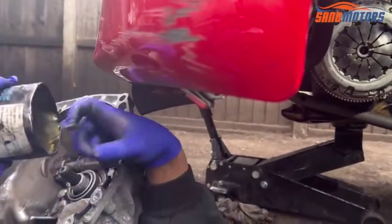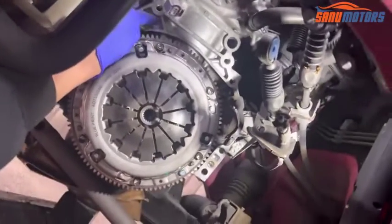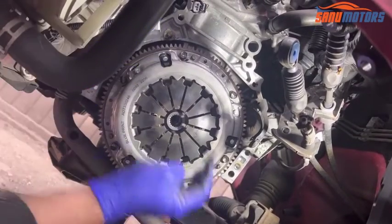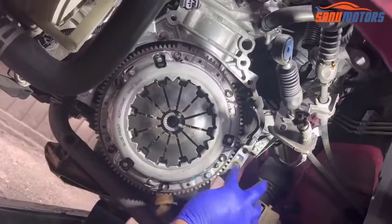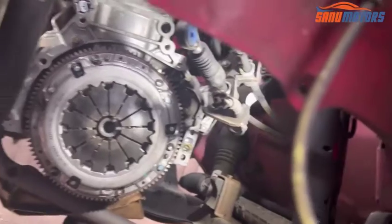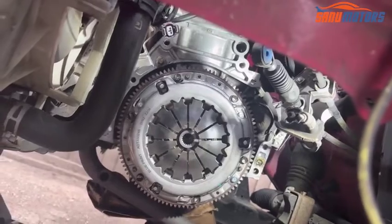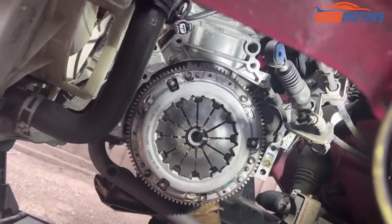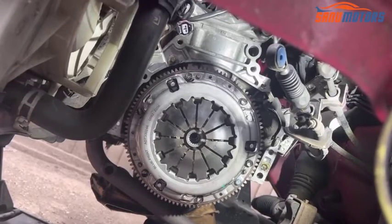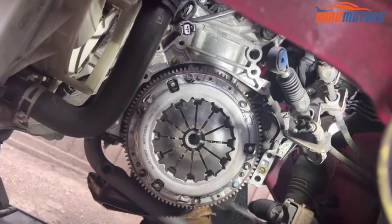Remember I mentioned before, this is the lining pin, you have to apply a little bit of grease here. I mentioned it earlier. After that it slides in properly, and here on the other pin I'm going to apply a little bit of grease. Job done. Now I have to lift up the gearbox. I'll show you another tip on how to lift up the gearbox. Stay with me, take a good idea, but always safety first. Keep in your mind, if you're not sure, don't do it.